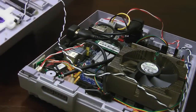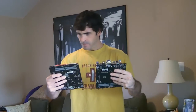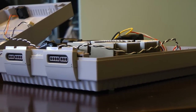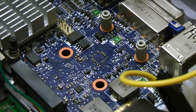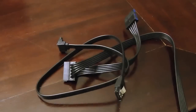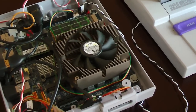Starting with the inside: the first difference from the previous video is a new motherboard. The original motherboard had issues unrelated to the build, so I had to RMA it — but this gave me the opportunity to go with something completely different. This is a thin ITX Intel motherboard, and as the name implies it's a pretty thin board, which allows for more room inside the enclosure. It also has Mini SATA or mSATA, which lets you use a mini PCIe slot as a hard drive connector. The drive is incredibly small, which solved the placement issue and eliminates the need for hard drive cables.